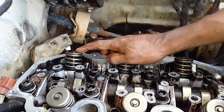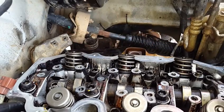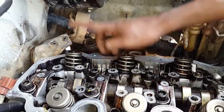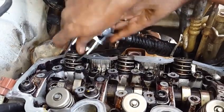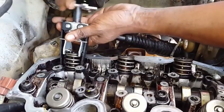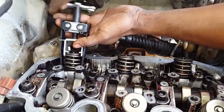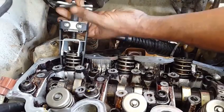Let's move on to number six cylinder exhaust valve spring. This is the hardest cylinder to do anything at. What I'm looking at is the clearance between the valve and the brake booster. I don't know if this tool is gonna fit in here. I hope it does, because if it doesn't then we're gonna have to take the cylinder head off. Apparently it looks like we're getting away with something here.